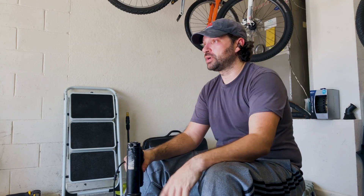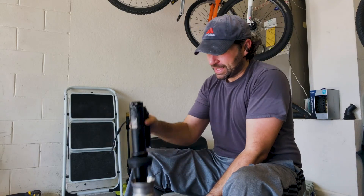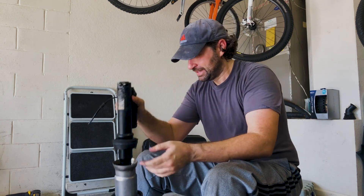If you want to convert everything to springs, you've got to make sure you get sway bars in it. This car doesn't have sway bars because the air suspension keeps everything level, and converting messes up the ride. The reason you buy this car is because it rides so smooth. If you want a sporty ride, you set it to sport one or sport two and it's rock hard. Paying about $300 a corner - if you replace all four, that's $1,200 - that's pretty much the price of a set of decent coil springs. So why go to coil springs? Then you have to replace everything, weld in a sway bar, do all those things. Just change them out when they fail, maybe once every decade, and you've got a perfectly good driving car.